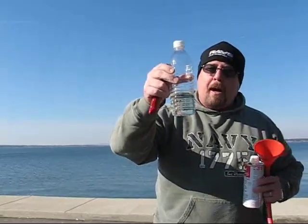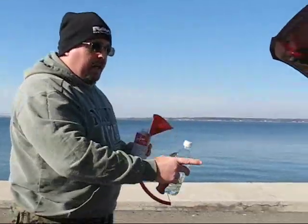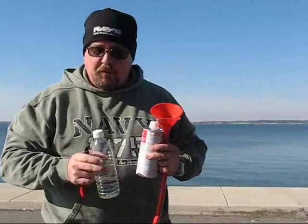Now, I got all the tools I need to do this entire job. I got this hose over here with a funnel already attached. I got my Seafoam. I got my little cheat sheet bottle over here, which I drew a little line on because you're going to use 1/3 of this bottle for each application. Again, the gas tank, inside the oil, and inside the intake manifold. And you'll see how this will come into play for the intake manifold. Very important. And I also got a wrench.